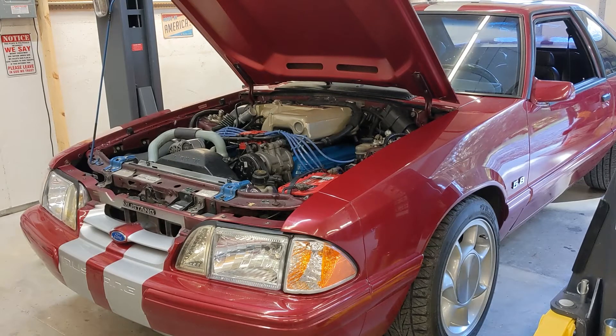The current modifications to the car include a 351W. I bought a 351W short block — it was bored 40 over, bringing it to 358. This car has 30-pound injectors, a 75-millimeter mass air meter, BBK shorty headers ceramic coated, a Cobra intake, lightly ported from the upper to the lower intake and from the lower intake to the heads.